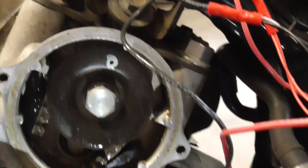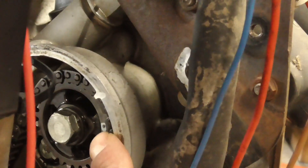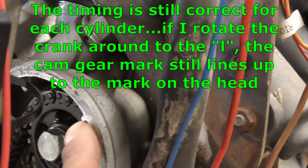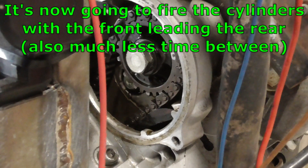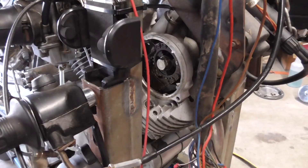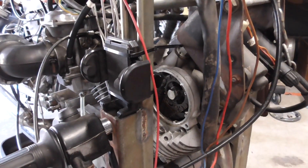With that adjustment, as you can see, I've got my T in the window and my rear is timed up here, lining up to the mark more or less — this chain guide is a bit loose. Now when we go around to the other side, you can see my dot that's on the gear — it used to be on this side, now it's over here. So what's going to happen is when this one sparks and fires, it's already advanced past it. This one's going to fire right here, then immediately it's going to make just a little rotation and that rear cylinder is going to fire. So it's going to change how the cylinders fire — they might be firing much closer together — but we're going to see if that makes a difference on the air fuel ratio mix. Let's put our coverage back on, then fire it up and see if that makes a difference on how the motor sounds and also the air fuel ratio with this single carb intake.